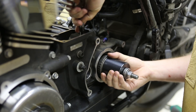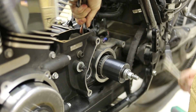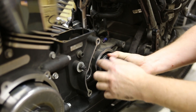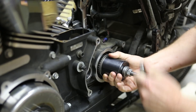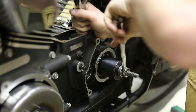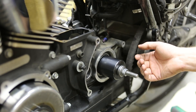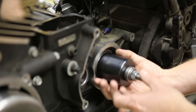You're going to take the wrench and go in from the back side and hook onto the bolt. Then you want to take your other wrench here and just start running it in. Once you get a little tension on it, you'll be able to hold this cup side and hold the tension on it. Now that I've got a little tension on the bearing, you can see the wrench will stay up here because I'm keeping that torque on it while I tighten this up. Run these two in until they're tight and then you can leave the tool on there for now. We're going to go ahead and do a spin check — that's going to be for an audible level. This bearing feels like it's spinning freely like a skateboard wheel would. It doesn't have any weird stops so we know it's installed nice and straight.